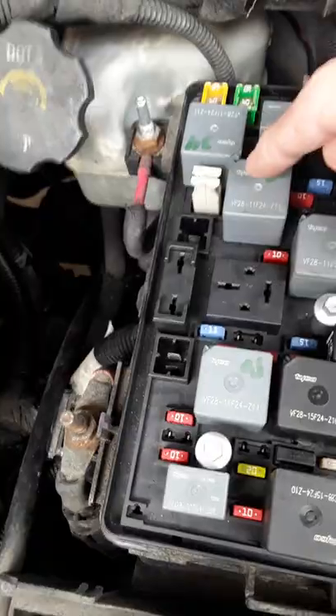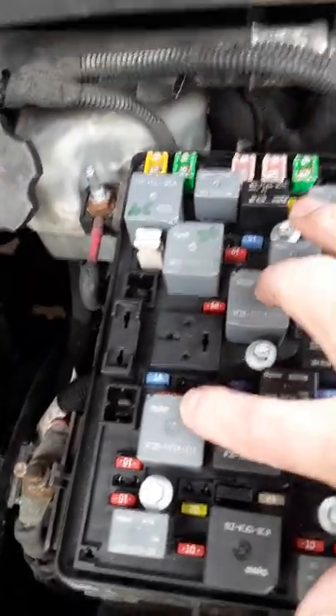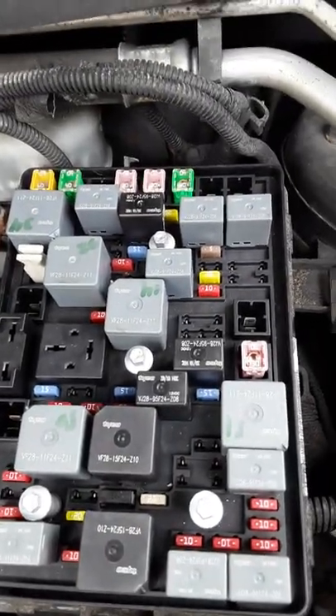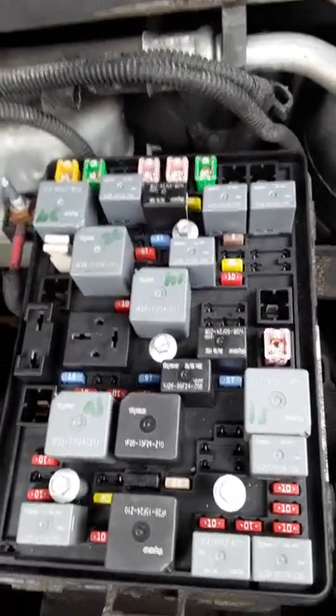This particular car has five Z11 relays, so I could switch out those five with the two ignition relays right here. All I have to do is swap them out and see what happens. If it works, you know the relay you were originally using is a bad one. If it doesn't work, you know the relays are not the problem.